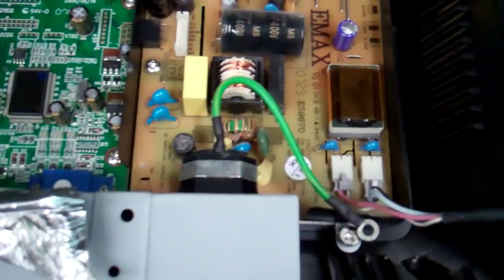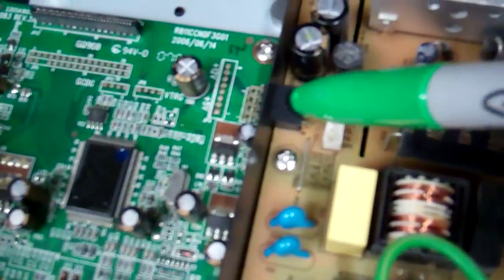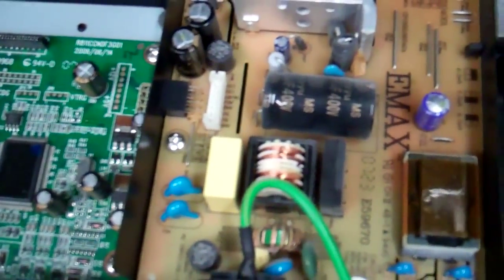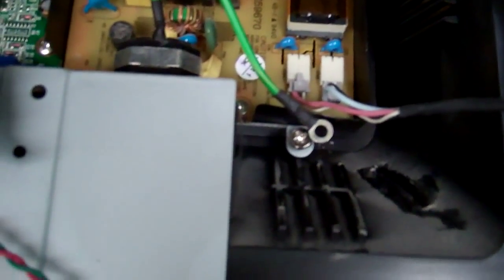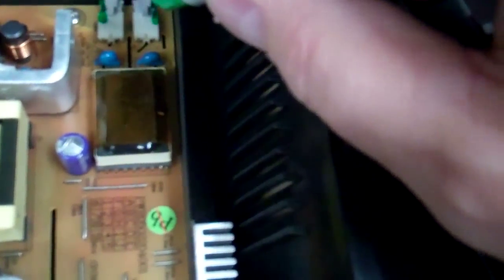The power plug plugs in directly, and there's a little ground wire. I removed that with a flat-head screwdriver. There are four connectors going to the backlight from the inverter. One thing I always do is take a magic marker and mark along the connectors so I don't get them mixed up - I put a green line along the outside edge so I won't forget how to plug them back in. To remove the inverter plugs, there's a little latch on the top: pry up to lift the latch and the plug comes out.